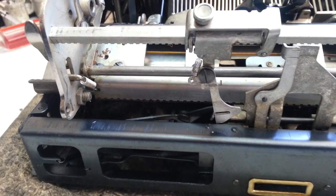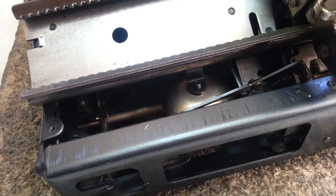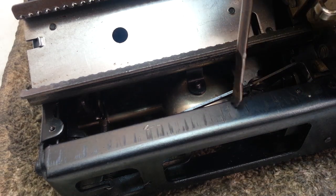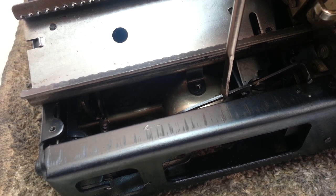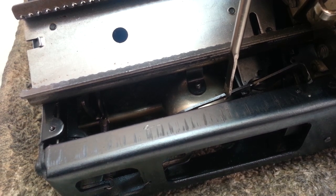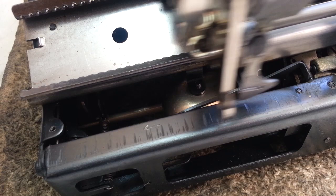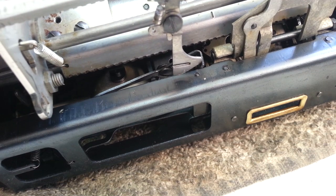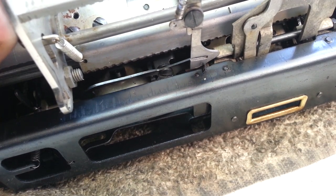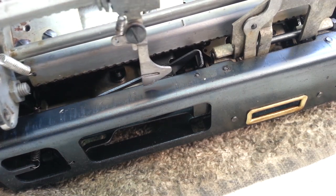So when the bell is, let me get this margin out of the way. Look at the bell here. This clapper looks like it's pretty close to the bell, and it is. You want it close but not touching. So if I push down on this, it's still just a fraction till it hits the bell right there. If it's touching the bell, it's going to give a duller sound. So let's try this again from this angle maybe. This piece connects there and triggers off, comes back, resets.